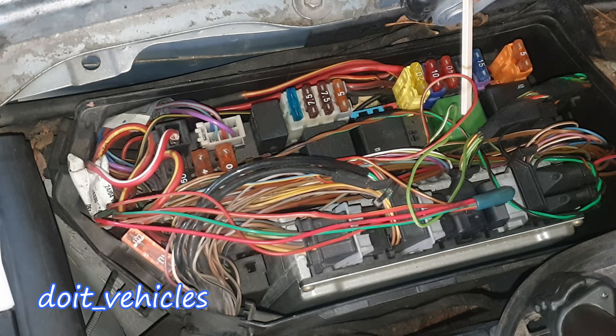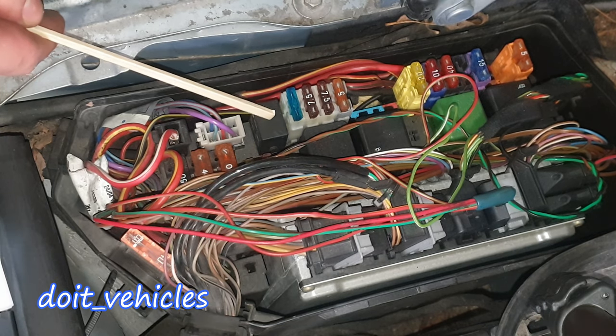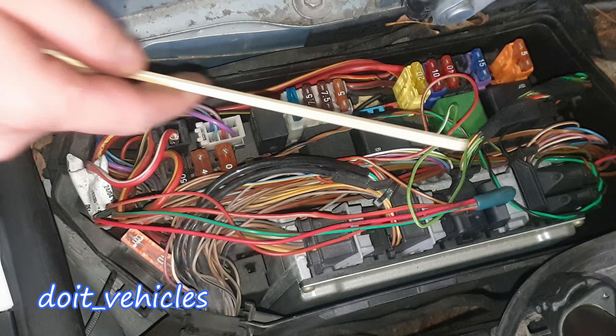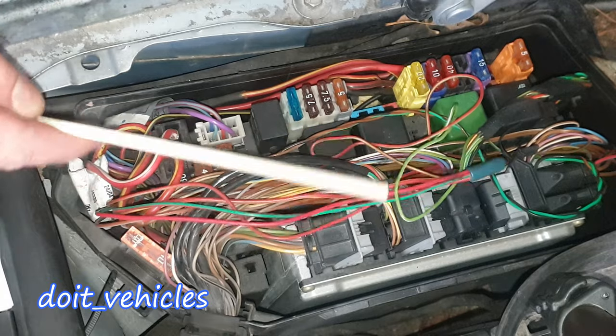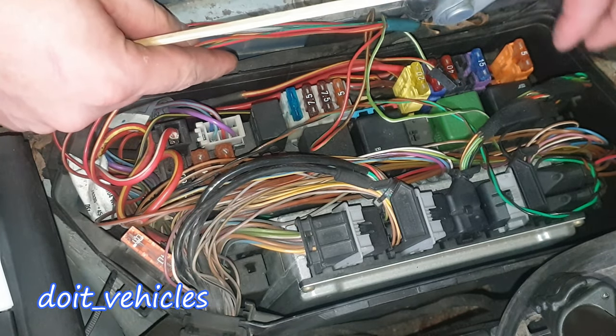This one says multi-function sensor — I'm not sure what that is. Engine and AC electric suction fan with integrated control. And this one is for the ignition coil. Now let's go to the relays. This one is for the engine electronics and chassis relay. This one is the starter relay. This one is for the secondary air pump relay. This one is for the air compressor relay for the airmatic system. And we've got the horn relay as well.